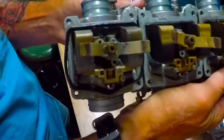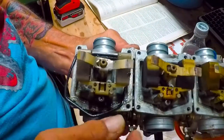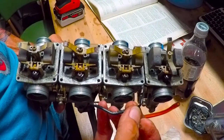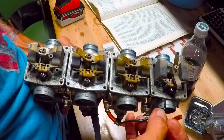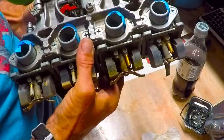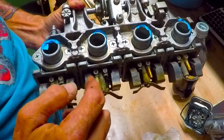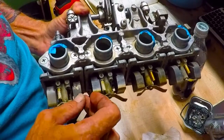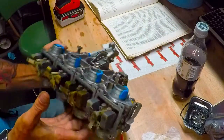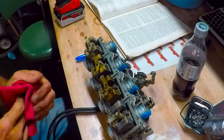I'm going to leave this last gasket on and show you guys all the RTV and how it has gotten inside. That's something you never ever want to do. If you're having a problem keeping these gaskets on — these gaskets expand over time — and if you try to reuse them like the previous owner did, you're going to run into issues. Number two is pretty cruddy here — not too bad but pretty cruddy. But all in all I'll bet all I'm going to be doing is just blowing passages out and cleaning everything up.